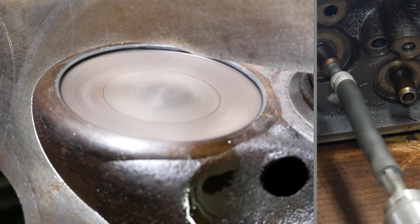As one final step, we'll take our assembled cylinder head and play it like a xylophone once more. We're just going through this to make sure all of the keepers are fully set in the retainers and nothing's going to pop out of place. Nothing sprang down and hit me in the eye, so I think we're in good shape. Much like so many of our other engine parts, we'll surround that in plastic wrap for storage and set it aside. Then we can finish reassembly of our second cylinder head. Again, luckily but surprisingly, this went without issue. And with it assembled, that will get wrapped up too. It's been a bit of a process, but that's what it takes to go through and try to make the best out of a pair of rusty iron cylinder heads. These will be set aside and wait until we're ready to reassemble the long block. And we're almost there — there's just one more episode to get through before we start putting that back together.